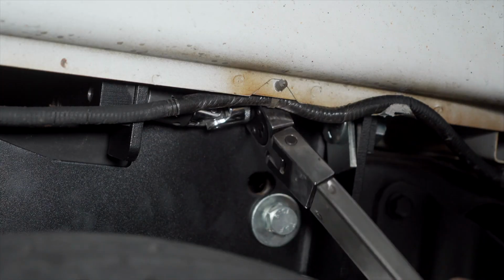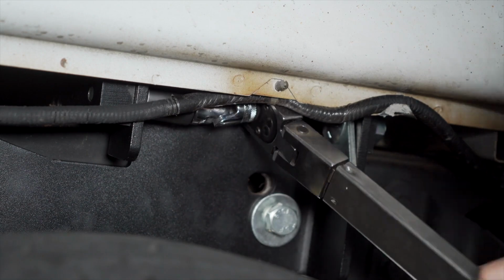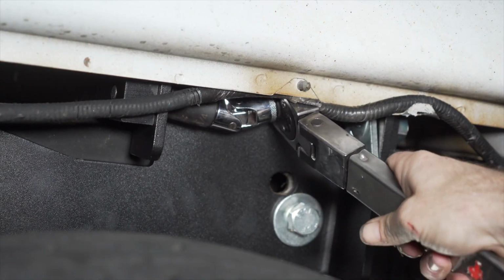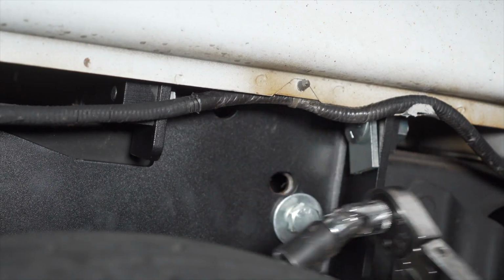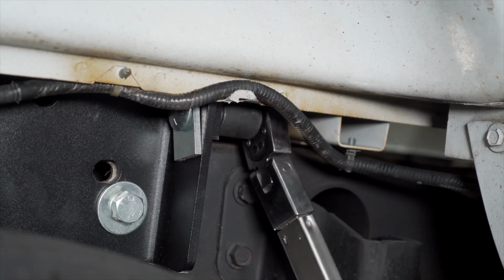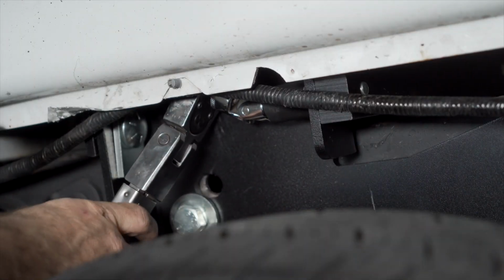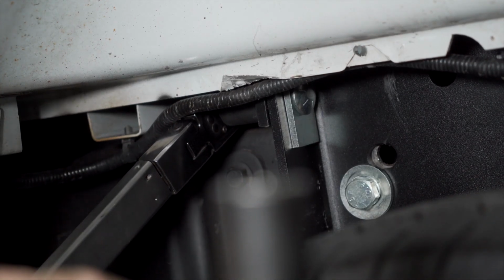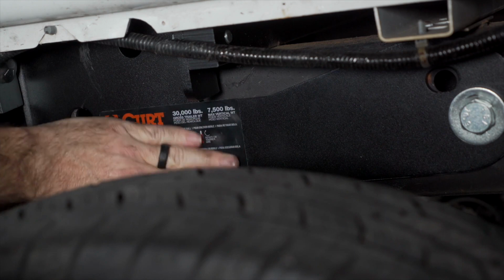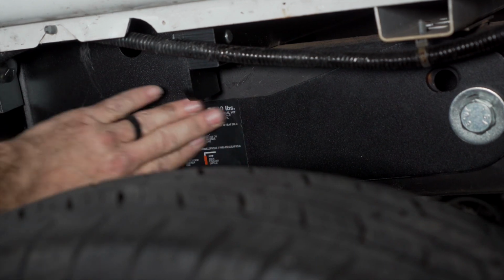You can now torque your final bolts, which are the side plates, to the cross arms. Start with the threaded bolts with a 3/4 socket and perhaps a swiveled elbow. Then torque down the larger carriage bolt with a 15/16 socket. Now repeat for the driver's side. You can apply your weight rating sticker to the driver's side underneath where the handle will be installed.